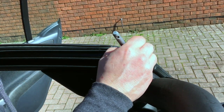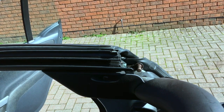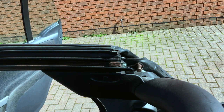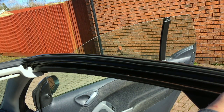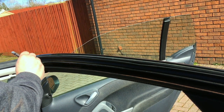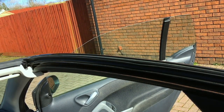Next we're going to start to pay attention to the rail. Apply it quite liberally — now the rail itself I noticed, because I do use this a lot. Apply it quite liberally into the channels, but you don't want massive globs in there. Literally just dab the grease onto your brush and run it along the channel on the inside. Try not to get any splashes — if you're splashing you're putting too much on. Just run it along there.